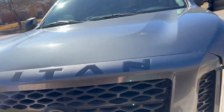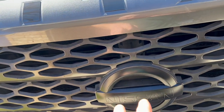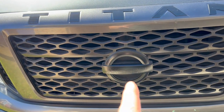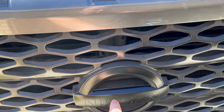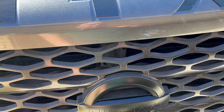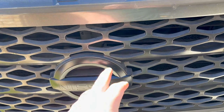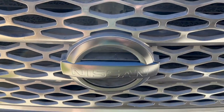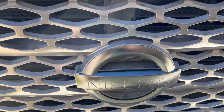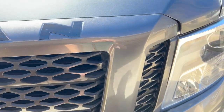And I'm gonna show the picture of the sprays that I used again. One tip I will tell you is when you're painting these letters and all that stuff, you need to get closer with your nozzle when you're spraying, okay? I sprayed them from like 6 inches and did the light coat through a whole bottle, and I did the whole second bottle till I was at the very bottom of it. I started getting close because I could still see speckles. So make sure when you're getting near the end, start going heavier, which means you might have to get a little closer with your spray bottle to make sure you're totally getting everything covered, okay? So let's look around here.